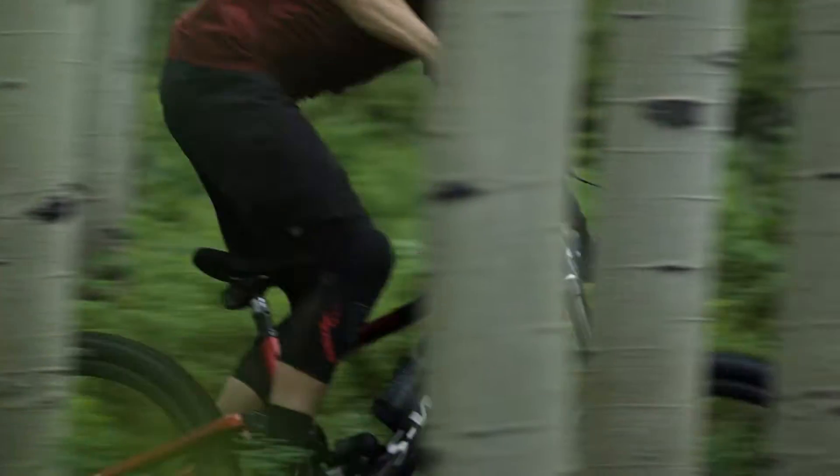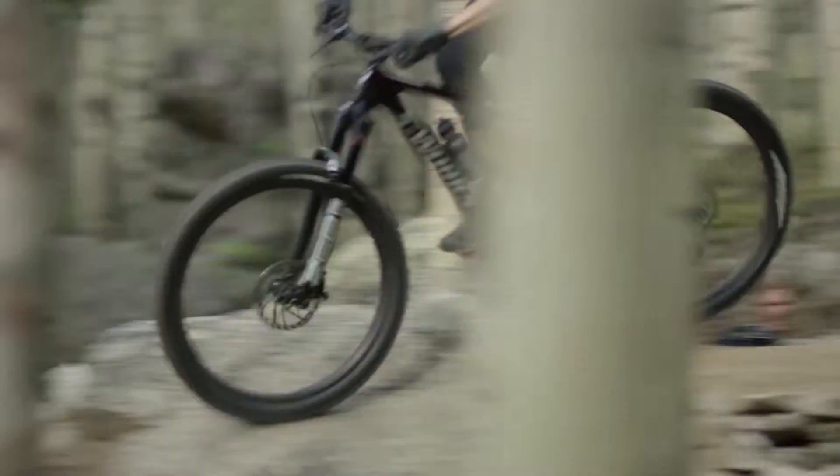There are different levels of friction. There's static friction, which we would call similar to the parking lot test, where you have that breakaway — that initial torque that's needed to free up the suspension — and then once that's active and you're going through the stroke, you have dynamic friction.